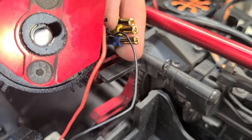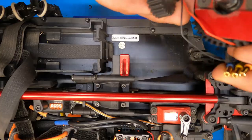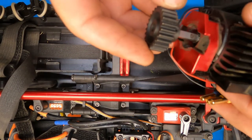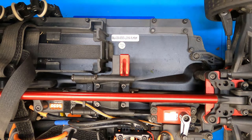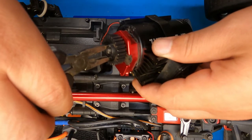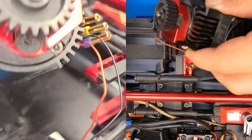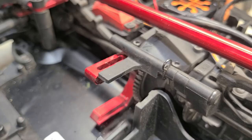As per most of the motors, it's going to have a flat spot on the shaft — grub screw side. So put that on there. I'm just going to go ahead and slide that over, and then the little c-clip goes back on. See that little groove that it's going to want to slide into. Just kind of get it started, take the pliers, just kind of squeeze in — click — in place. You want to rotate to make sure the grub screw is on the flat spot.